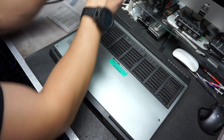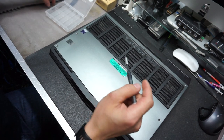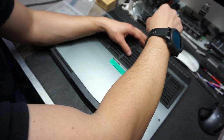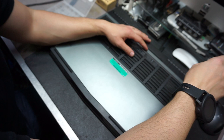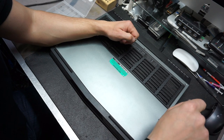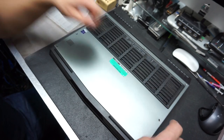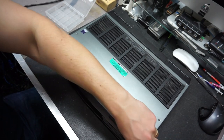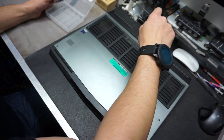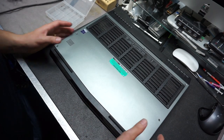Keep in mind that if the computer is actually shutting off because of heat problems, this process won't really help on its own. Changing the thermal pads and paste might bring down the temperature by a couple of degrees centigrade — don't expect miracles. However, every single degree matters.